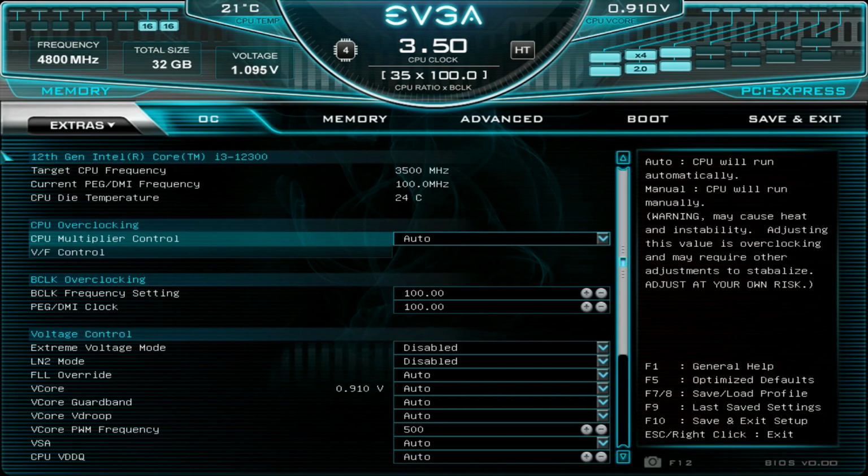They are very affordable, but as you can imagine, you definitely don't want to buy a 500 or 600 or 700 euro motherboard for a 100 euro CPU. That doesn't make any sense, right? So the most ideal case would be if we had very cheap motherboards that supported this function, like a 100 euro motherboard for a 100 euro CPU, or less than 100 euro motherboard for a 100 euro CPU. The feature that you need on the motherboard to be able to overclock these non-K CPUs is an external clock generator on the motherboard, and that's usually present only on the higher end motherboards.